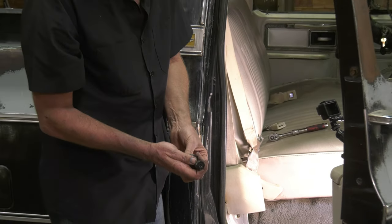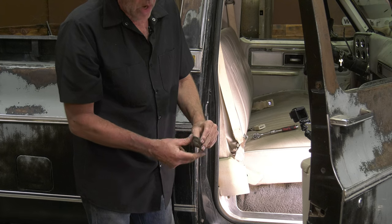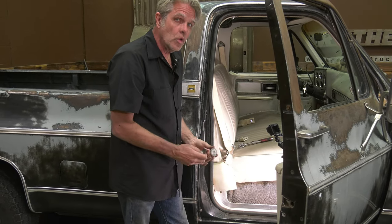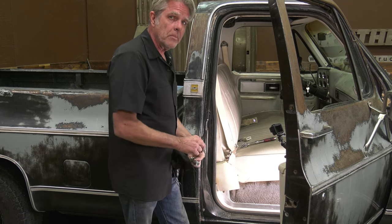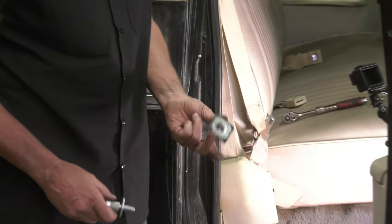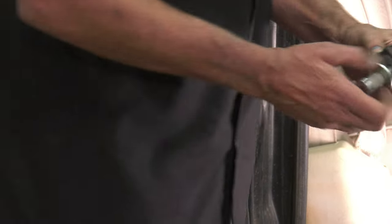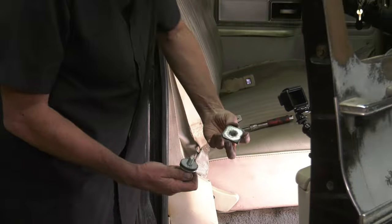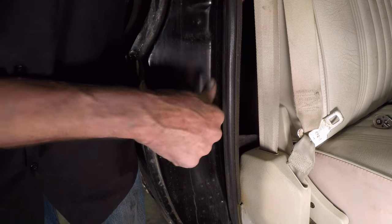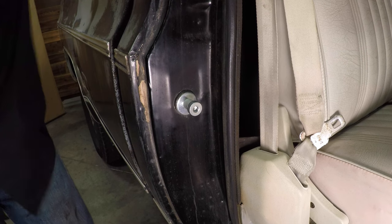On this one there are a couple of extra washers — one won't come off at all but the other two will. You might have two or three on there; they shim it so it's hitting in the right spot on the latch. More than likely it'll be correct, so I'll install the new one with the same number of washers, but we'll shut the door slowly to make sure everything's right before we finalize. The nut is on the inside of the door B-pillar — that's what this bolts to — and it sandwiches down to give a really firm grasp because this takes a lot of punishment. Just put it behind the B-pillar, screw it in, line it up to the existing ring, and tighten it up.